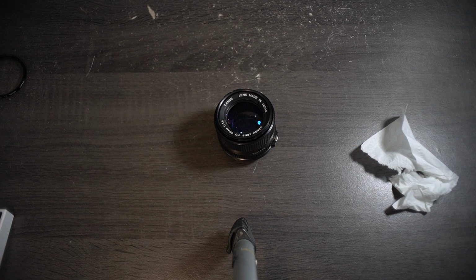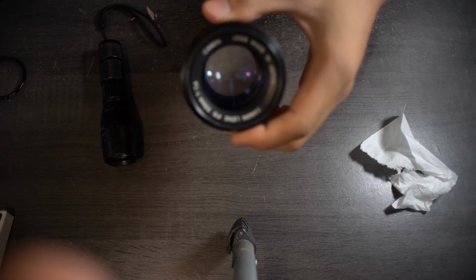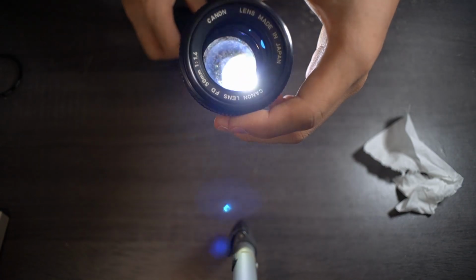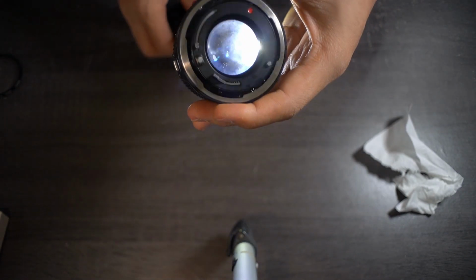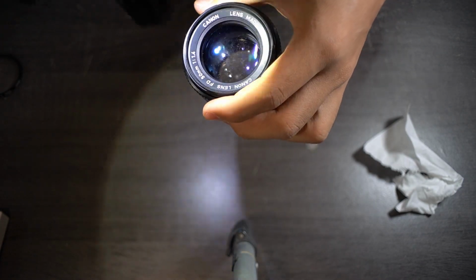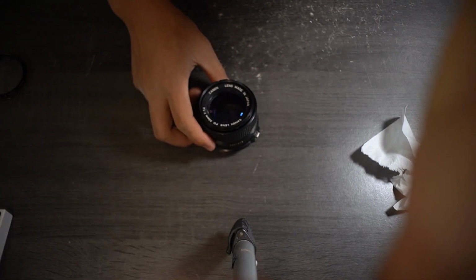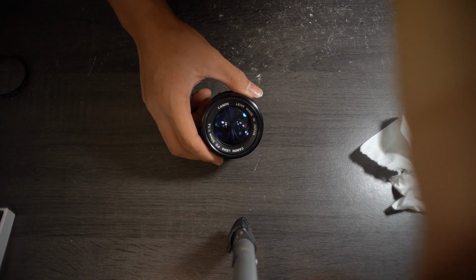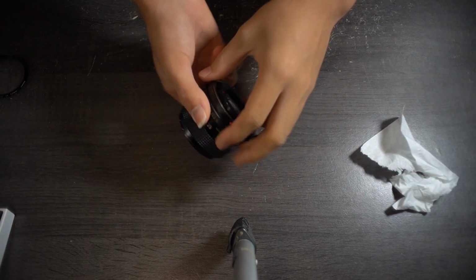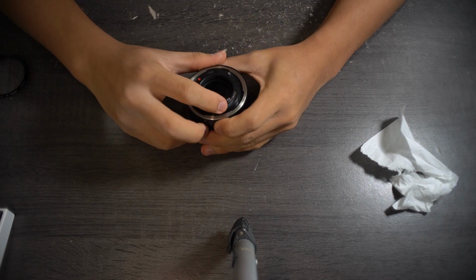For the one that was on the lens, that's this thing. So this, which is the 50mm f1.4, has some haze and I believe etching. I'm not sure though, yeah. So let me go try and clean this guy up. I'm pretty sure there's some fungi on the front of the aperture, I mean inside the aperture bit here, yeah, but I'm not sure what's in the back. So let's see. First, let me go show you actually how to open up the aperture, yeah.